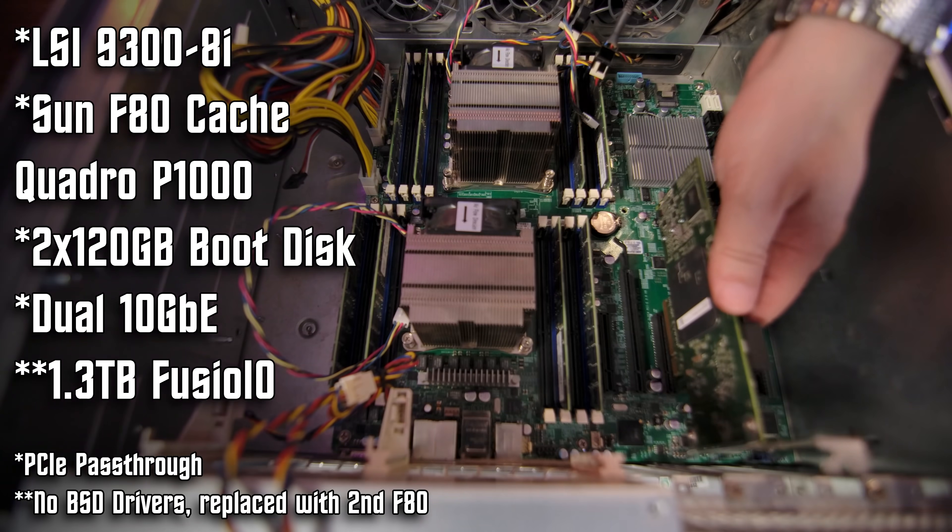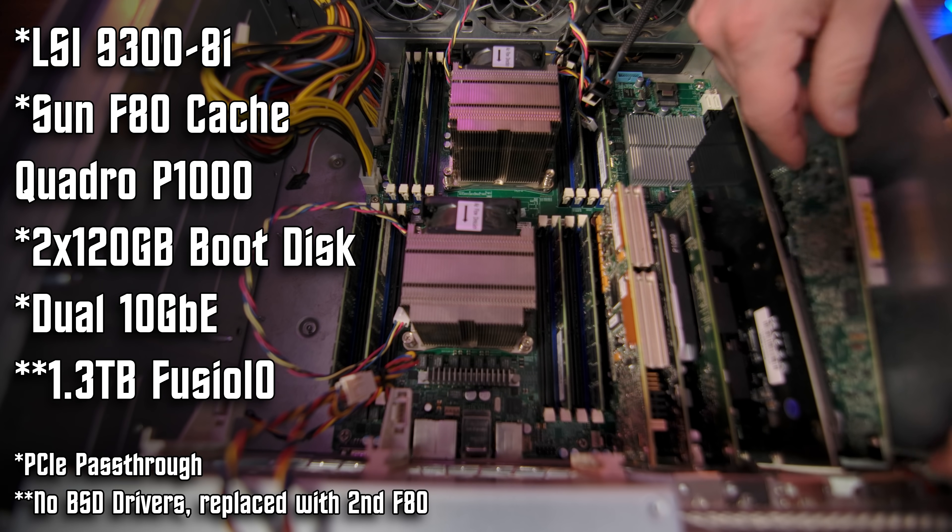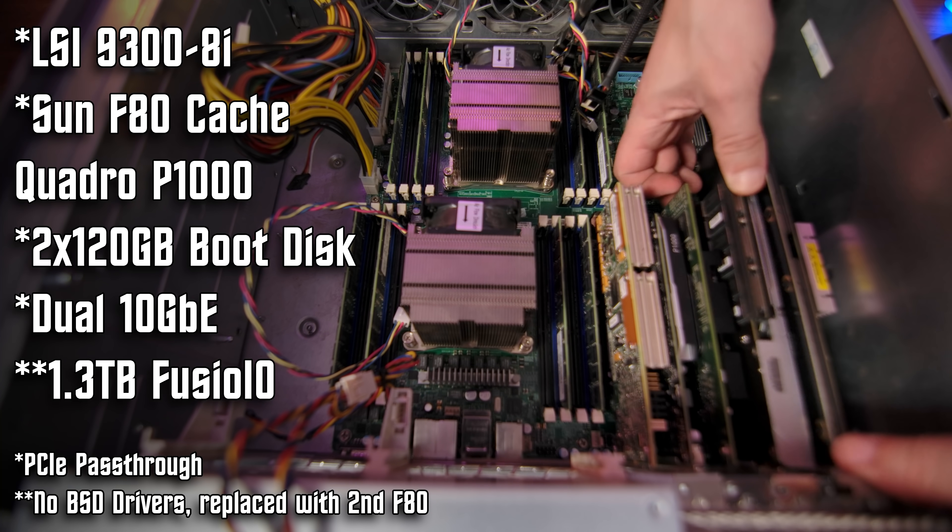The main reason for that is I had a fair number of issues getting IOMMU set up on this board, especially with the number of PCI Express devices that I wanted to pass through. Essentially, I wanted TrueNAS to have physical access to five out of the six PCI Express devices I installed in the server. So why am I bothering to virtualize it at all? Secondly, I wanted TrueNAS to have access to all 128 gigabytes of memory, meaning I would have had to fully allocate everything inside of the virtual machine, leaving none left for any other VMs. Also, the fact that I installed eight-core, eight-threaded CPUs meant I was locked down to not nearly as many threads to distribute across multiple virtual machines. So running this on bare hardware seemed like the best alternative.